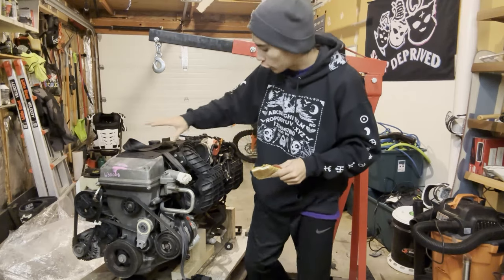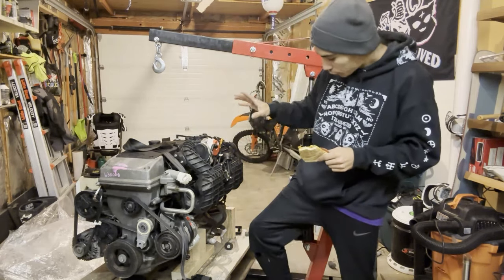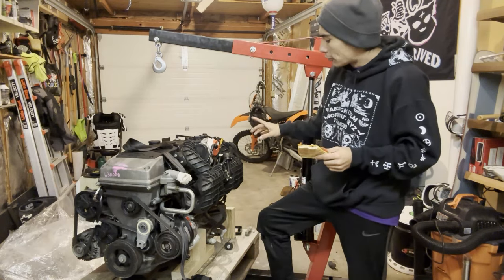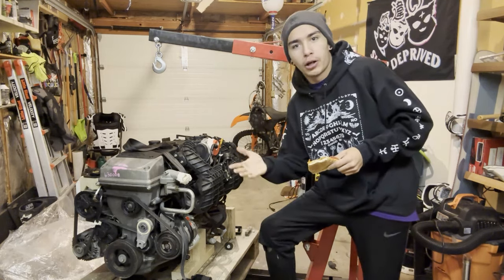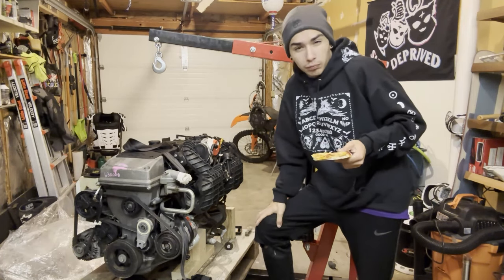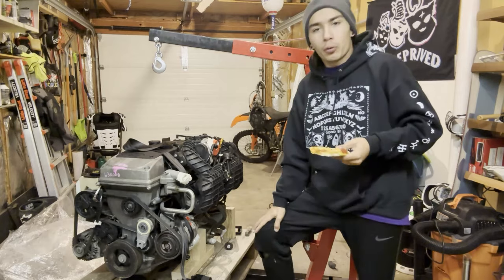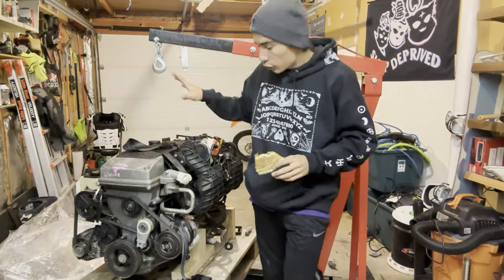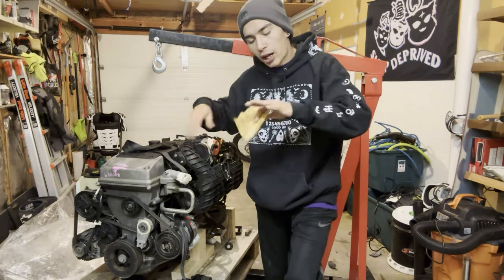And also, the other concern: I chose rear sump for a reason. The car is stock rear sump. I have to make sure it clears the subframe and the steering rack. I don't think it's going to clear steering. And a lot of people have cut it, and then moved it or expanded it or shortened it, as long as the pickup's fine and you tie them in together.